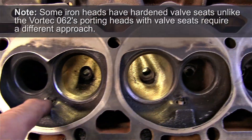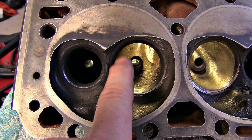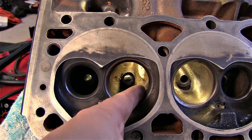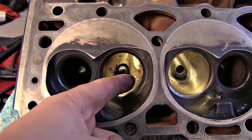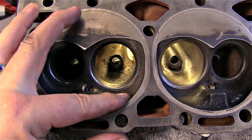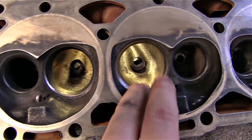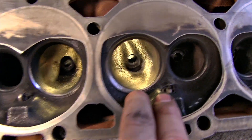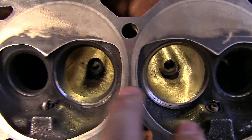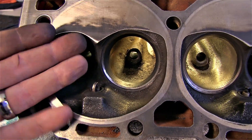Look at how much larger the finished bowl is compared to the unfinished one. No one explained this to me — I just read some books and figured it out. Air comes in here and ramps off the bowl surface, then hits your valve. Before blending, air deflects off the valve and doesn't flow cleanly into the combustion chamber. When you blend the bowl smooth, the air deflects off the valve less and gets more flow into the combustion chamber, which is what you need to make more horsepower.